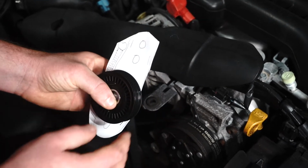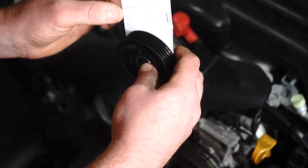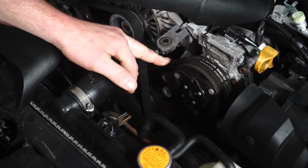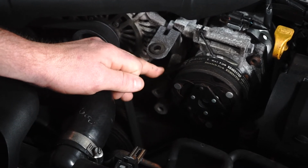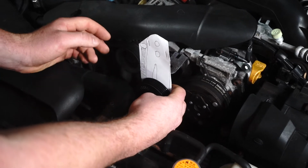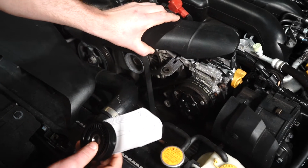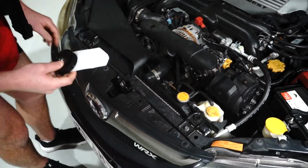And then at this point, guys, you want to tighten that 14mm adjustment nut. It will go down. It will push your pulley down like that. Tighten it to where you push down on the belt. You see that? That's a great example. It can only move about 2 or 3 centimeters. Should feel nice and tight. And at that point, once you've got it to that tension, you do up this front 14mm nut on the pulley, and that would be the job complete. Obviously, you just bring this back and press that back down into place like so.